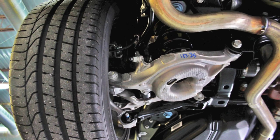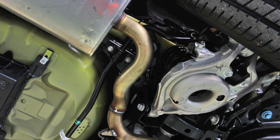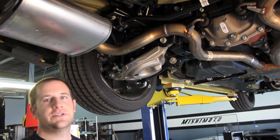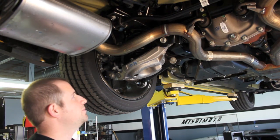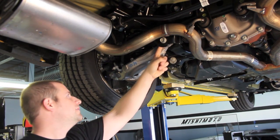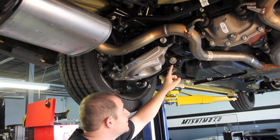Like I pointed out in the front, because we have the performance package, the rear also uses quite a few of the spherical pillow ball bushings as well as the front. I found there are three areas, three bushings here that use a pillow ball — there's one up here, one here with the knuckle, and this one up here.